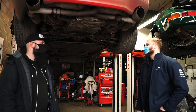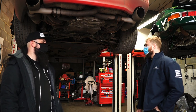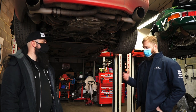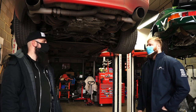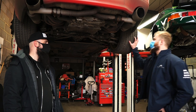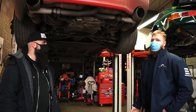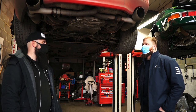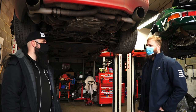You might think, I've got four-wheel drive so I've got more grip — well, that's not going to stop you braking. You want as much grip as possible. I'd recommend investing in a second set of wheels so you're not changing over — maybe a cheaper set — put the winter tyres on and store your summer tyres and wheels. Also look at the health of the tyre and your tyre pressure, because in winter when it's cooler your pressure's going to drop slightly and you won't be running as well. Always check your tyre pressure when it starts getting cooler. You can see a significant drop in pressure, which might make the difference between losing control or staying on the road.